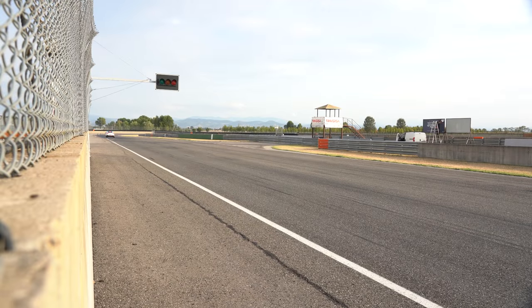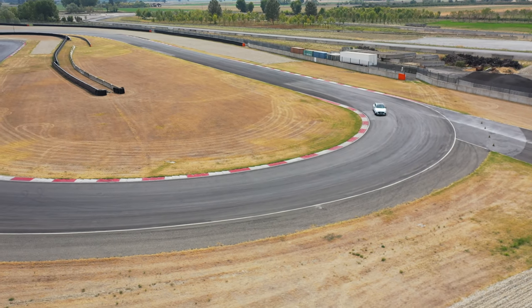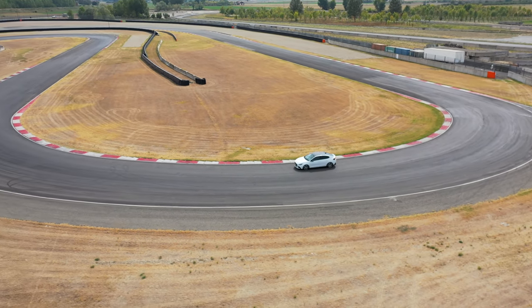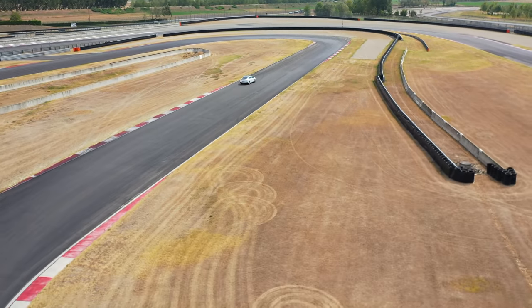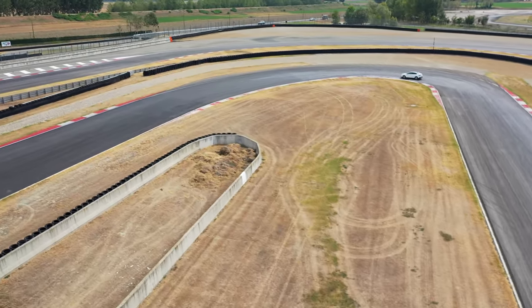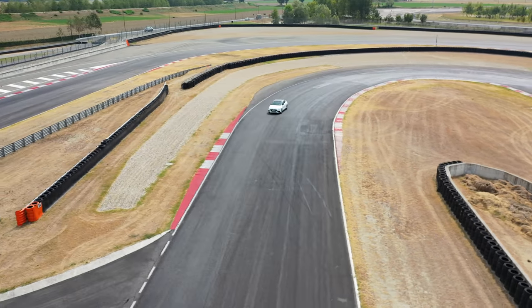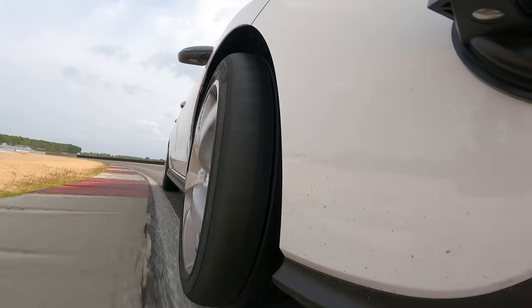How was it on the Hyundai? Well, it felt delicate. You had quite light steering and the accuracy and precision probably wasn't as much as I'd want even for a road tyre on track, but lateral grip was good and braking grip was excellent. However, you just had to be really delicate, especially mid-corner at apex and corner exit. I was tickling the throttle — this car has 300-odd horsepower — but even with the clever diff you were still scrabbling for grip, pushing wide with understeer, and that's where I felt I was losing a lot of time.